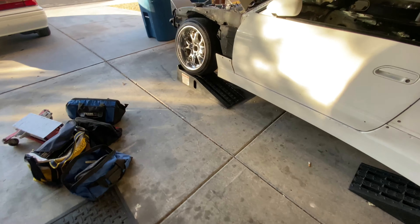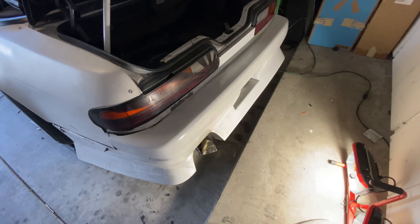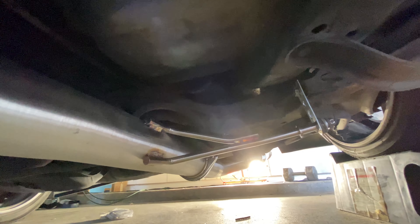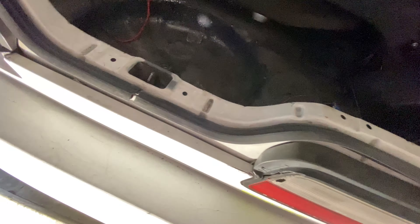Now it's full ISR from the headers to the mid-pipe to this new dump pipe, which I highly recommend. You just got to get a little creative because the mounts aren't necessarily where they're supposed to be, so I just did what I could — but that shit sounds good. I can't wait to drive it. Battery relocation coming soon. I want to utilize that mount right there to make some brackets and mount my battery back here. Battery relocation will probably be the next video. And then I want to flock the dash to clean up the interior a little bit, reinstall the dash.